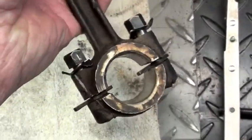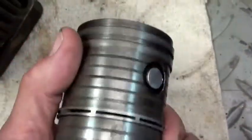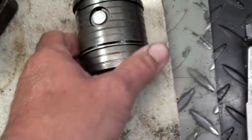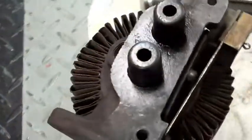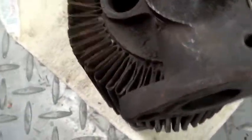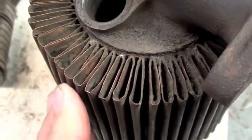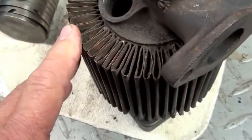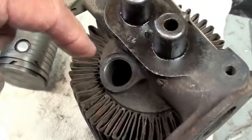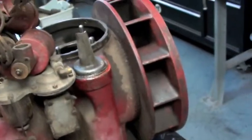We've got shims, the rod bearings are in good shape, and generally looking pretty good — cleaned up very well. An interesting feature of this particular engine is the copper heat sink material that's been added to the cylinder. The airflow flows down through the top, through the fins, and out the bottom then out the fan.